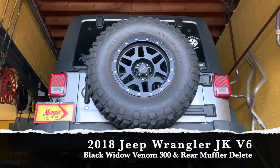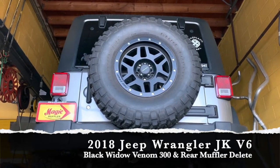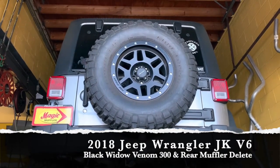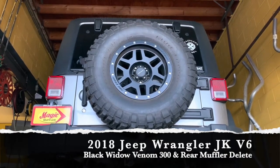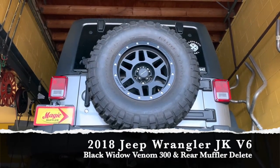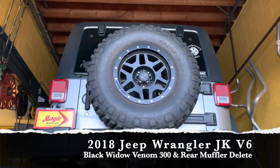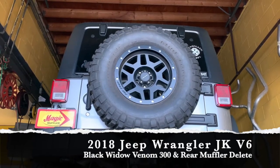As you guys may recall, I've told you this engine — while it's a good reliable engine, makes good power — it is a little bit whiny. With most V6s, they kind of tend to start out as an eight cylinder if you know how to do it right, but they tend to end as a four cylinder. And this one tends to do that more so than most; it definitely tends to be on the high pitch side of things. So the customer wanted something aggressive, and I did explain you don't want to get too loud because that four-cylinder sound will come out real quick.